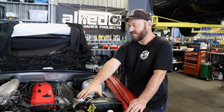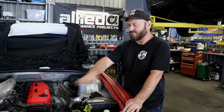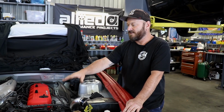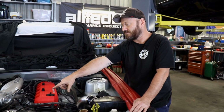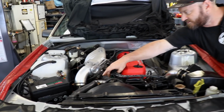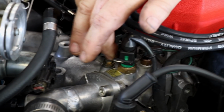These cars in particular have this engine retrofitted and they have a weird radiator in them that is renowned for being a pain in the butt. Nissan engines in particular have little bleed points on them, which this one's only got one left. There was one up here previously when it had a different manifold on it. That's a little bleed screw there.